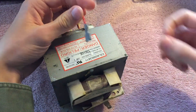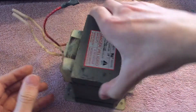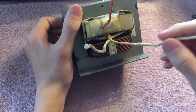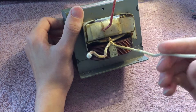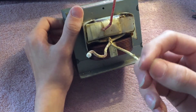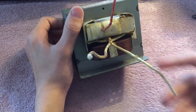If you want your over 2,000 volts, you just go across here and somewhere on the chassis — you could use a bit of sandpaper to rub the lacquer off. Right here is the third connection point. This is a small, low-voltage winding which is just used to power the magnetron's heating element. It's only a few volts AC, so unless you need something specifically for that, most people just cut these off.